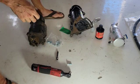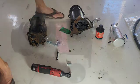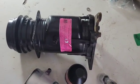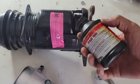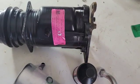All right, they are good and tight now, we'll get it back in the car. Reading this tag — it says this compressor is pre-charged with three ounces of oil, which works great because I said this thing takes 10 ounces. This bottle is eight ounces, so I'll measure it out and just put seven ounces of PAG oil in there.